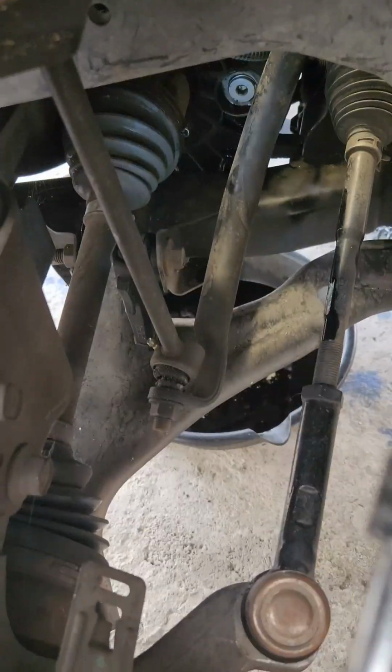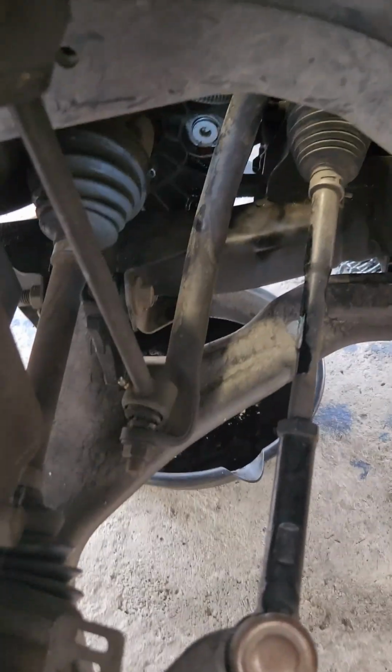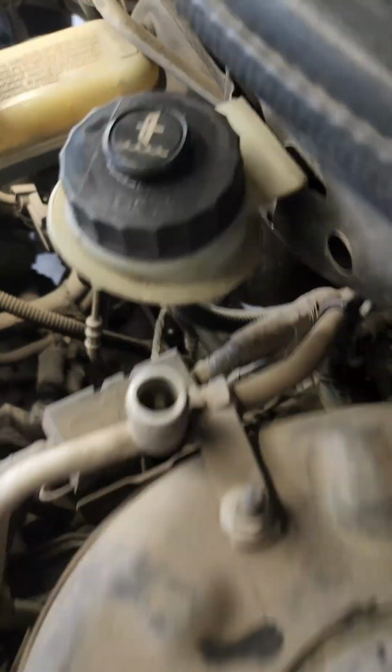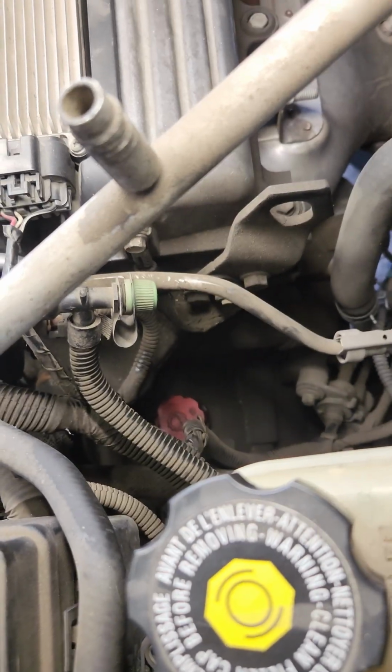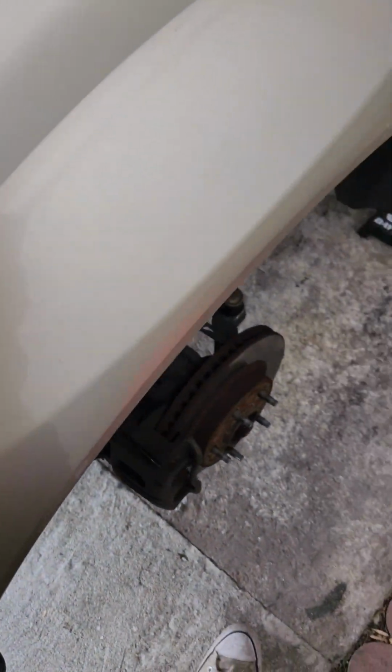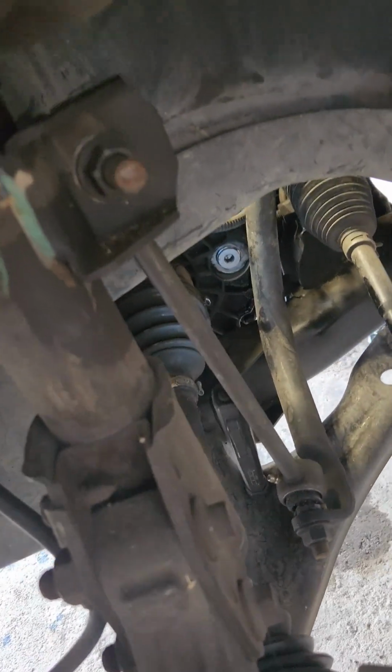The fill plug, again, 8mm hex or Allen, whatever you want to call it. I do believe they're the same, but you know, roast me in the comments if you want. And everyone, so yeah, once you sealed up everything, the fill cap right there is back on there. Had a little O-ring. Would be a good idea to put a little bit of ATF on there, lubricate it, but it looks like it was in good condition. Fill plug is installed, doesn't look like it's leaking or anything.